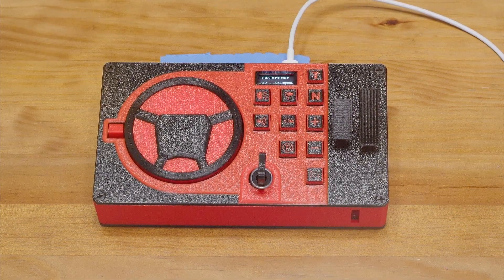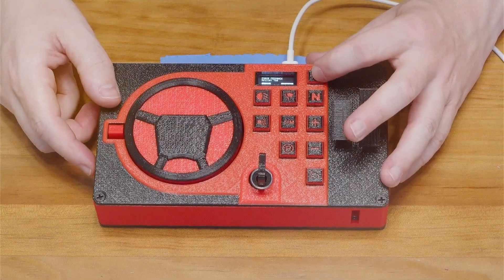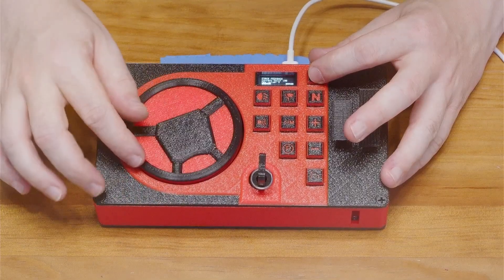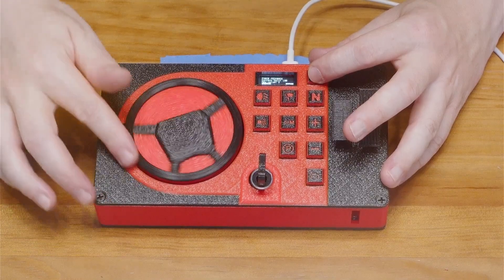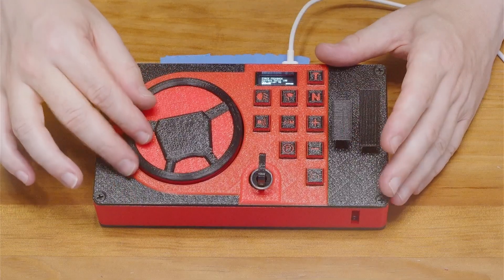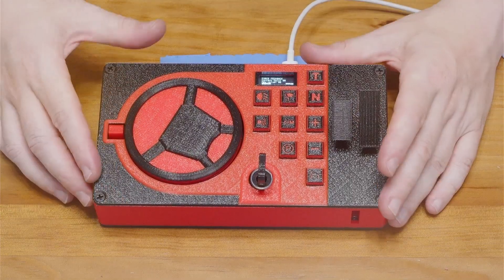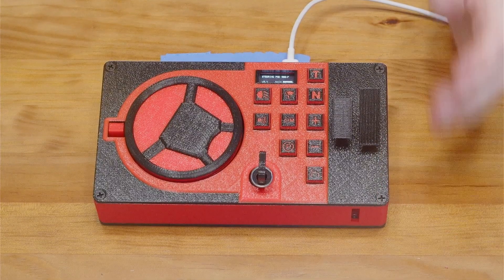Before launching a game, now that the steering wheel is calibrated, I go back into the menu to set the force feedback level. The steering wheel itself is used to set the number — that's why it needed to be calibrated first. I prefer to use it at 80, but this depends on the game, the USB port, and even the computer, as the power comes from USB only. Set, exit, yes — it's finally done and ready to use in a game.